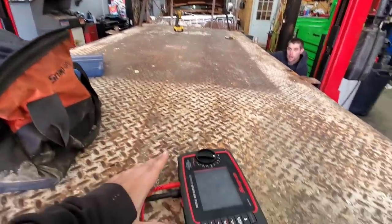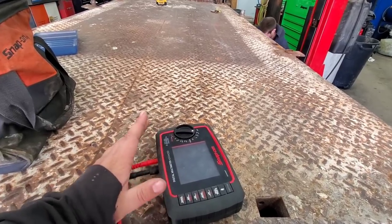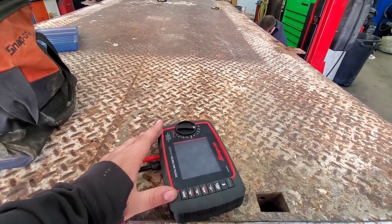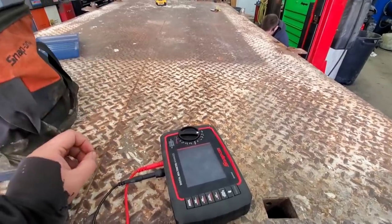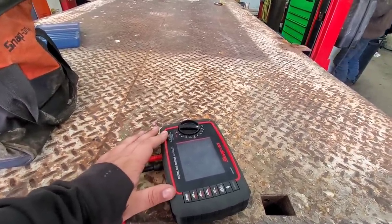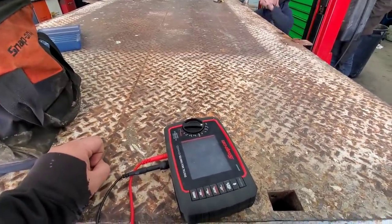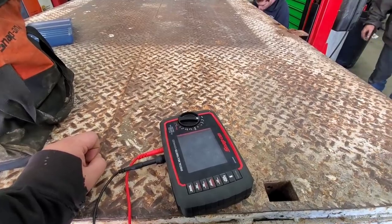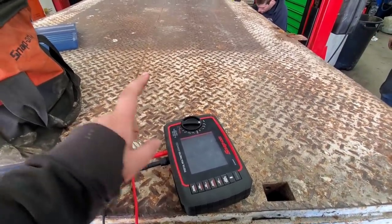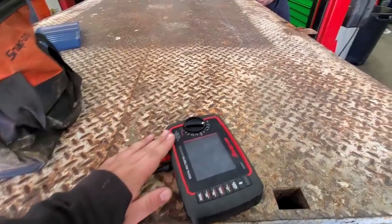So what this test shows us that we couldn't see with the resistance test is, this will show you if a wire is bad when it's flowing a load. A resistance test puts a really small amount of power through that wire. I mean, most meters have a 9-volt battery or some AAs or something. It's using that to run the voltage through the system to see what the resistance is by how much power makes it back. So if you have 1 or 2 good strands in a wire, it'll show up good on resistance, but it won't work.